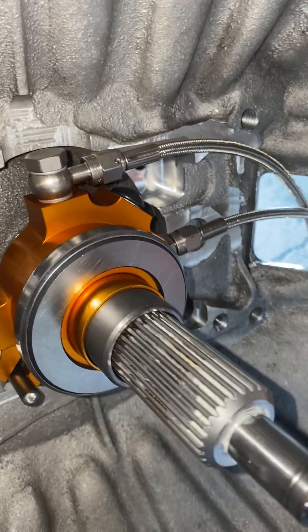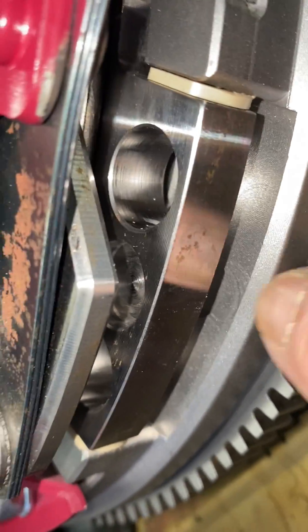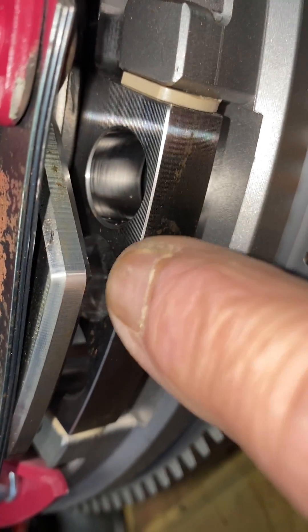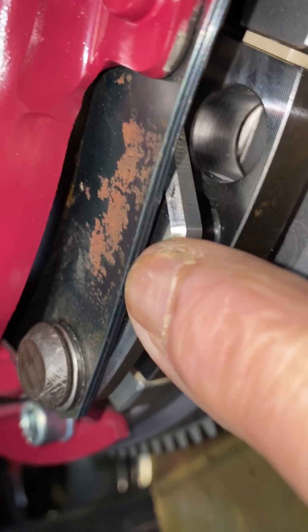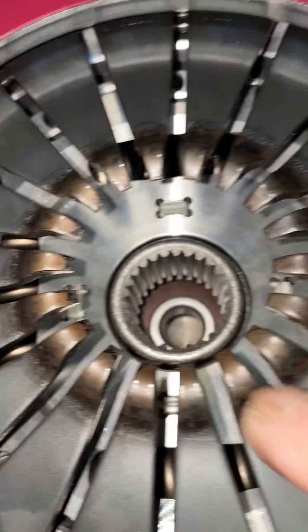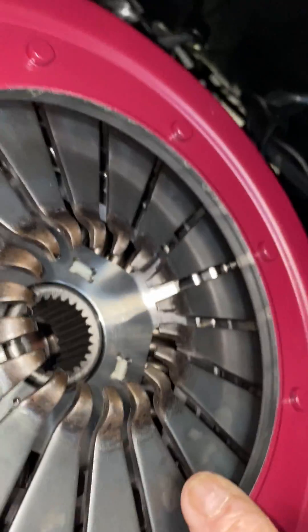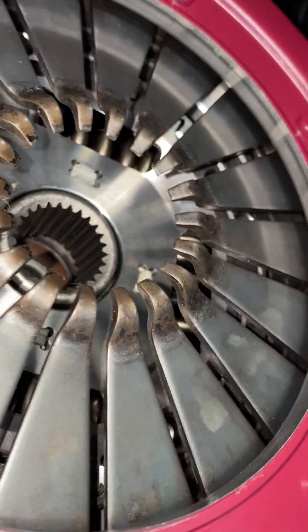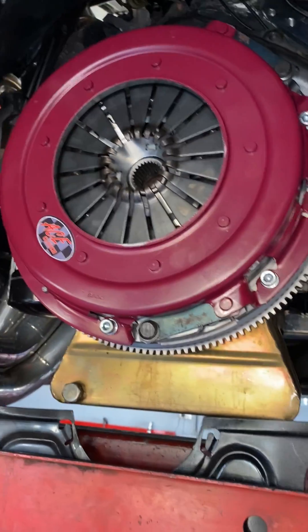Getting to our clutch — this is what we've done. This is our own clutch; it's a twin plate. It features a billet steel flywheel, billet steel intermediate plate, billet steel base plate and a pressure plate, so it's much much stronger than anything else on the market. And a billet steel boss in the clutch, single spline hub and also a sprung hub — if you can see the springs inside there — so it's quite a versatile clutch. It's a ten and a half inch clutch, capable of easily holding the power level of this vehicle.